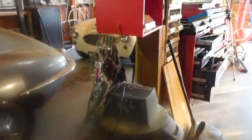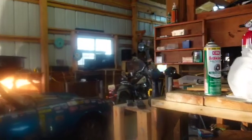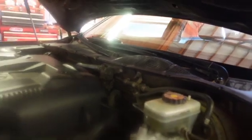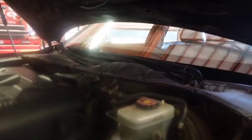So that's what the inside of a relay looks like. It's nothing but an electromagnetic switch that runs direct power to the unit, but that's all it is. And that one's going away. And we got two new Bosch ones sitting over here. Put that right there. And we're going to see if it's just a bad relay and if the fan comes on, and then if we got power to whichever one it is.